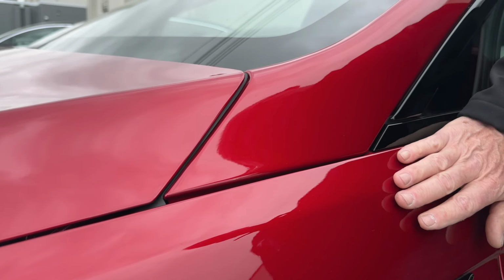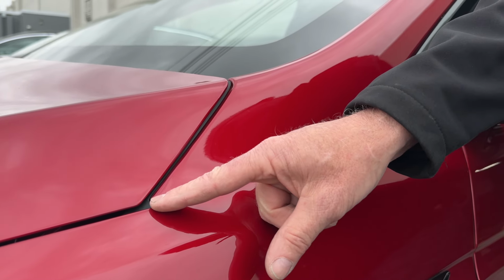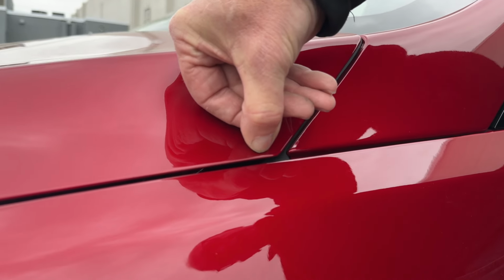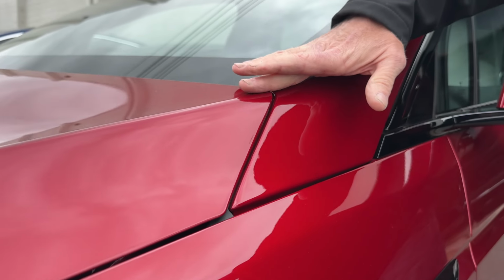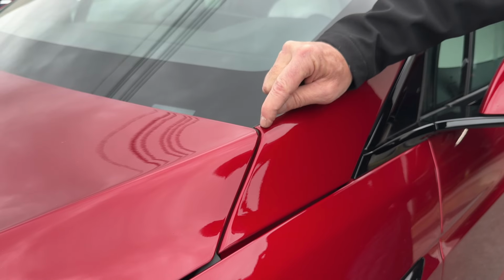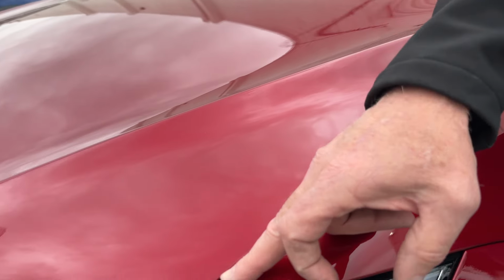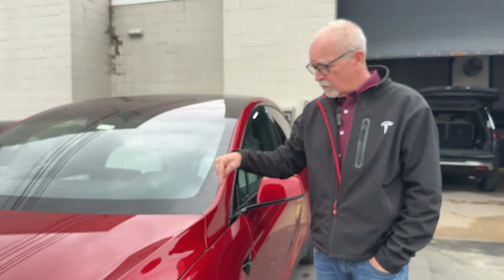So we know for sure, because I can't move this one, if I want to get this line right, this fender's got to come up to close this gap. If I'm going to move this, the hood also has to come up. If I look at this line and draw a straight line across, you could see it would really be here. But at the same time, I've got a flush issue with the hood to this fixed panel, so I can't really come up too much. What else could I do? I might be able to send this corner backward. I might be able to move this forward, maybe. But then what happens to this gap as we go forward? So here's a clue about what you need to do to get this vehicle right.